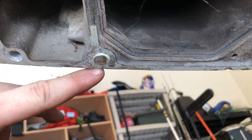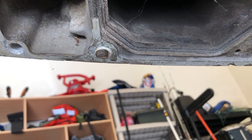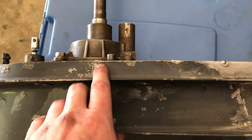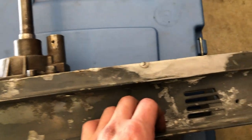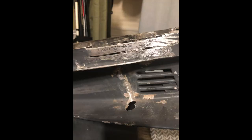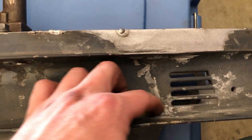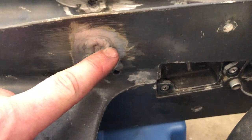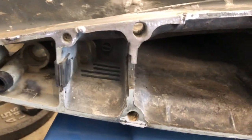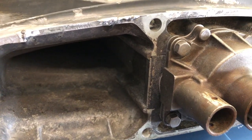Because I was not able to get that bolt out, I had to cut it with a cutoff wheel, and I ended up damaging the lower unit. So I took the lower unit to the shop and welded it myself to fix it. Here's the lower unit now — it's got what look like dings, but it's aluminum metal I haven't ground down yet. This is a new piece where I added a plate right here. There's also a radius I have to get in and do, and it wasn't pretty because it's cast, so there are a lot of impurities. I need to grind this all down level so it seats back correctly onto the outboard.